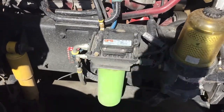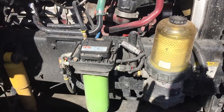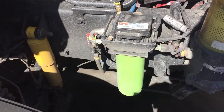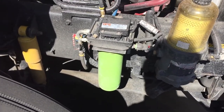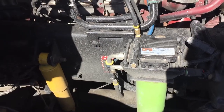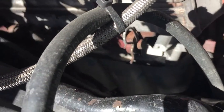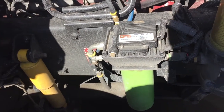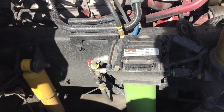The key to this is doing oil samples. I do oil samples every three months or 30,000 miles. What's good about it is I don't have to spend $400 every service for an oil change every other time. So every 60,000 miles I change out the main filters. I'm doing it this time because I'm doing a full refresh. My engine has 760,000 miles on it, so over 750,000 — I'm going to start doing a refresh every 60,000 miles.